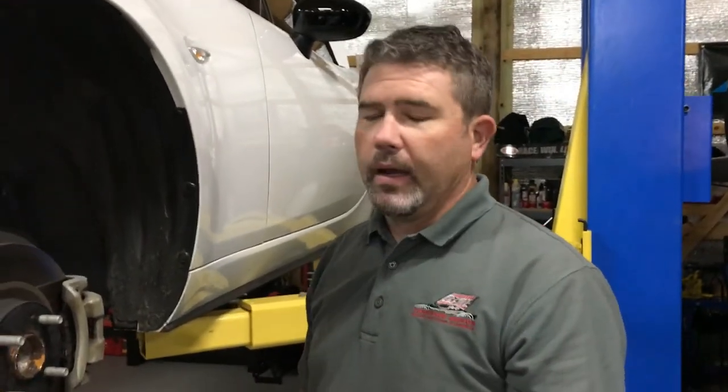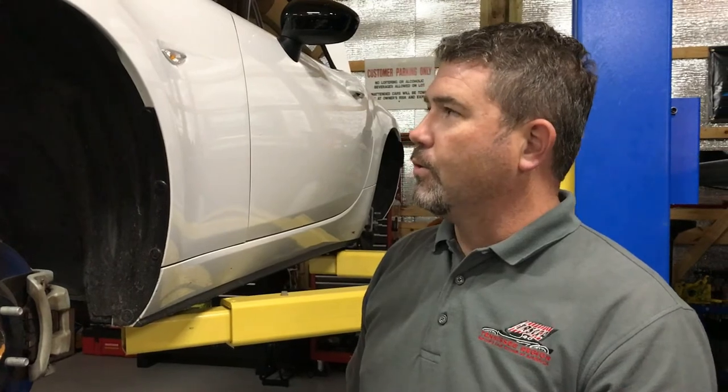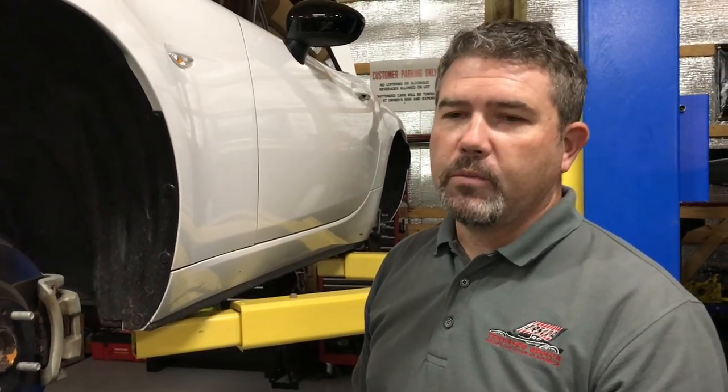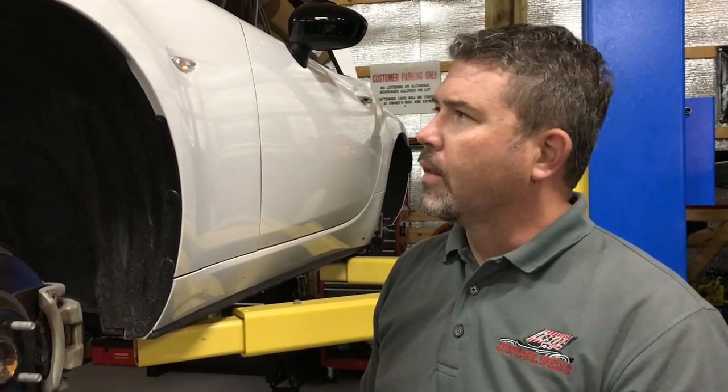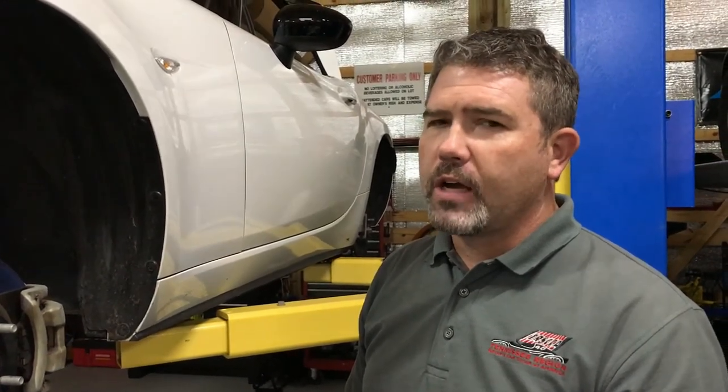So we had a little trouble on the rears. We got them, and in inspecting everything, actually went so far as to mount the spring on one of them. I lined the spring perches up. I realized I had to compress the spring a lot further for the JRI shock than the Bilstein, so that raised the red flag, and I started taking measurements. It was at that point when we discovered the rear shocks weren't legal.